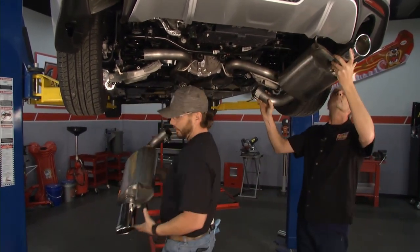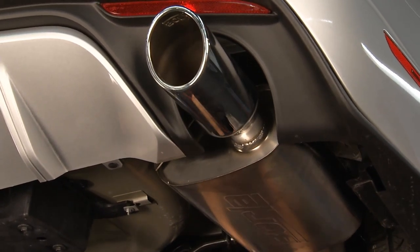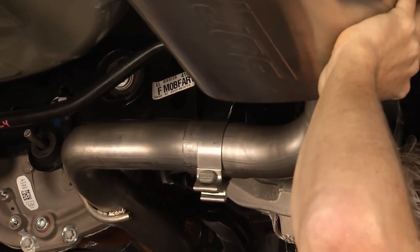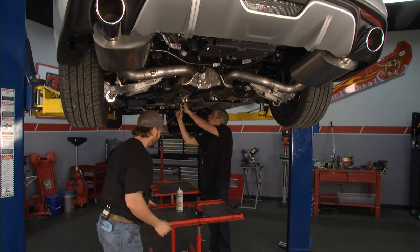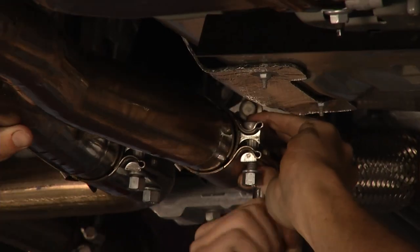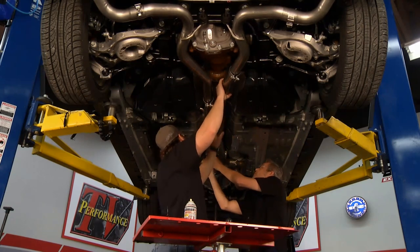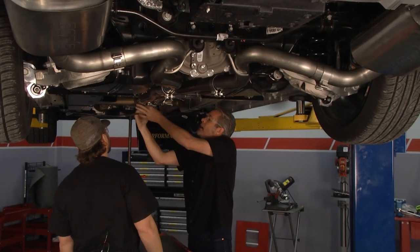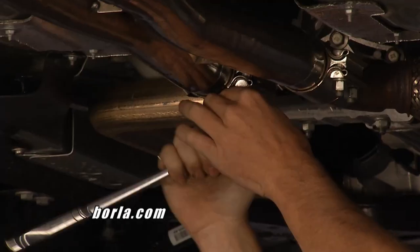The pipes slide into the slot. You might think at home this is going too easy, but you'd be wrong — Borla takes a lot of time to make sure these are going to fit perfect. When snugging everything up, make sure everything is level and square with the ground. Start from the front and work your way back. Keep in mind that mild steel rusts, stainless steel does not — that's one of the reasons Borla can give a million-mile warranty.